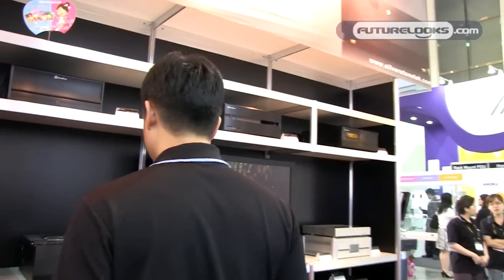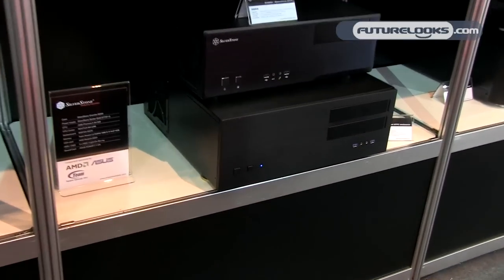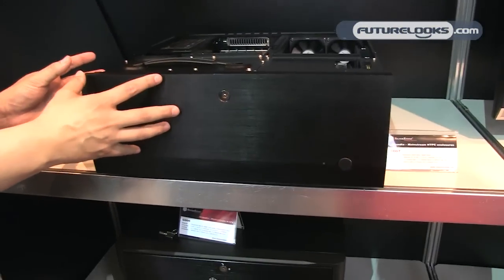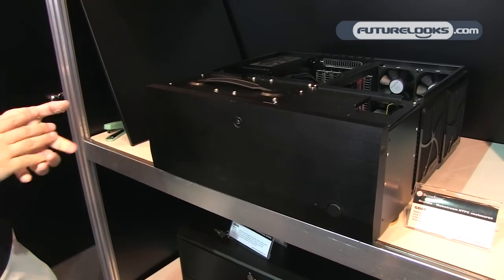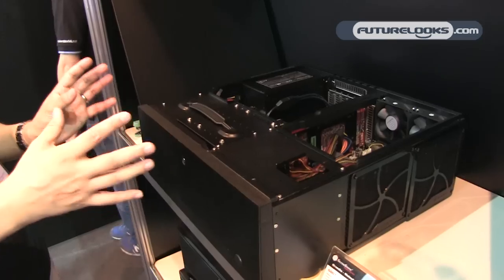For HTPC, we're releasing a brand new version of our full ATX-size HTPC case in the GD07 and GD08. With the new cases, we're able to keep the same dimensions as the standard ATX HTPC case we released back in 2005 with the LC16 and LC17, but we've upgraded the cooling ability and storage capacity. With the GD08, for example, you're now able to fit up to eight hard drives and five 120mm fans inside — the same case size as before.